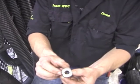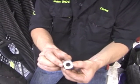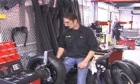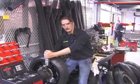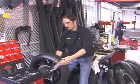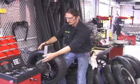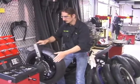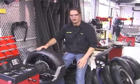The nut that holds the wheel and tire assembly on the spindle has 2 flats on it. Never use a wrench on this. When installing the nut hand tight, sometimes it helps to hold on to the bar and hand tighten it. After you have the wheel and tire assembly on the machine and the nut tightened, close down the 2 levers so that the tire and wheel assembly is now a part of the machine.